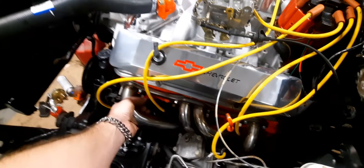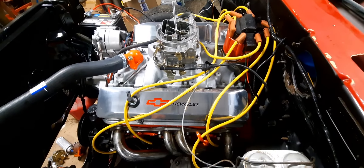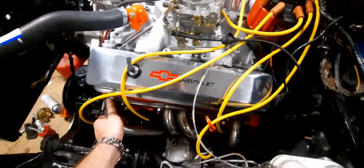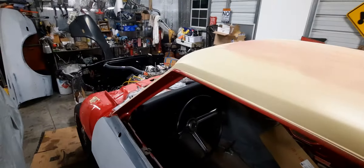We got a lot of stuff buttoned up but I figured you all could tag along. I've set a gauge up here just to check things out — super cold, haven't had a chance to start it yet. Want to see if this thing will start. The stainless is already getting dirty just sitting in the shop. Going to make sure the battery's hooked up. We know it started on the floor, but I want to confirm the wiring and stuff is right because I had to add the HEI wire harness — it was points before and I had to take out the resistor.